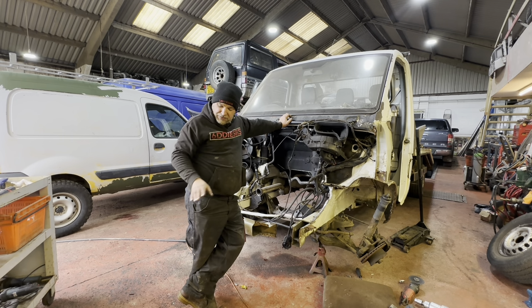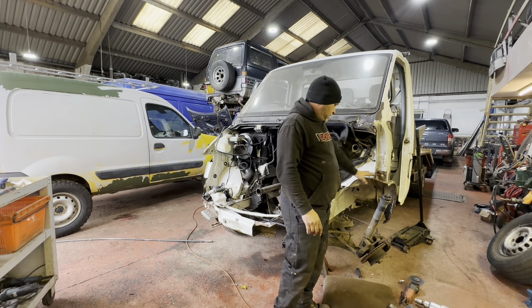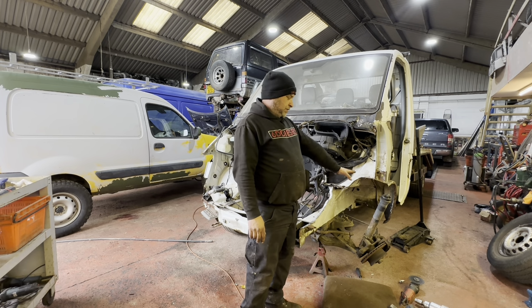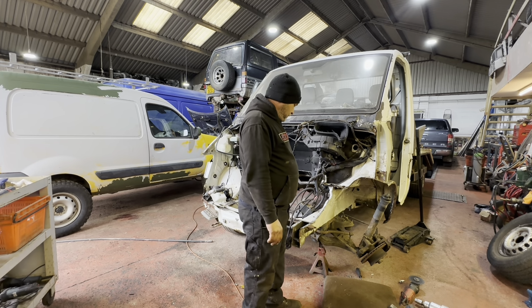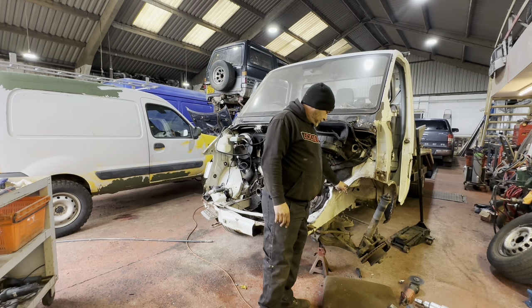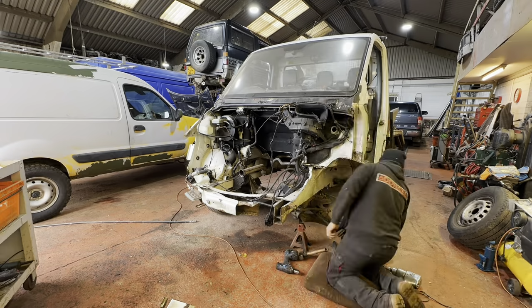So what I'm going to do today is finish putting in this massive section that you saw me cut out and sort of half scarf in the other day. So I'm trimming this bit, need to repair on that to get that in there welded up. You will see that I've quickly whipped the wheel off and we've moved the shock absorber out of the field of grinding. So I'm going to get all of the gack and the underseal off of here so that it doesn't catch fire when I weld it together. And then I need to trim the lip off of the bottom of here, but leave this bit so we get a nice join on that bit. Here goes.